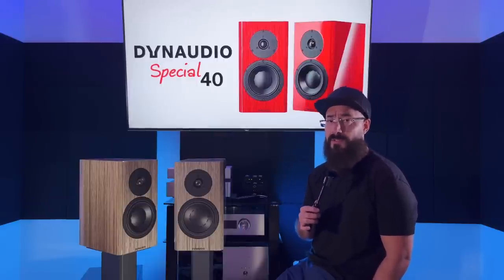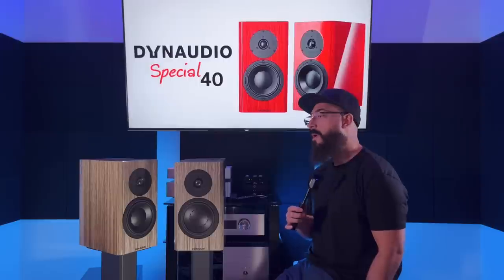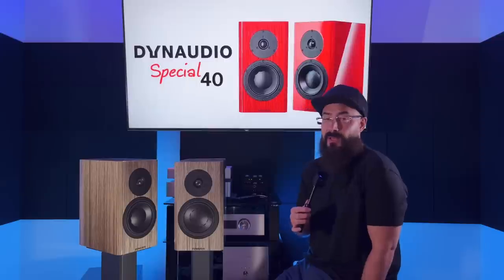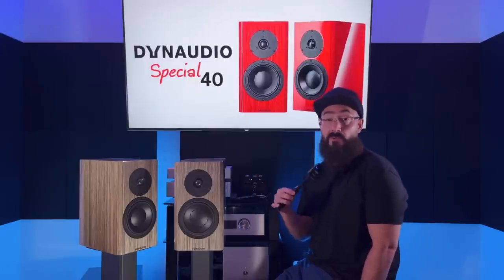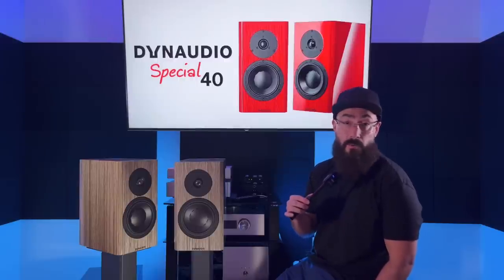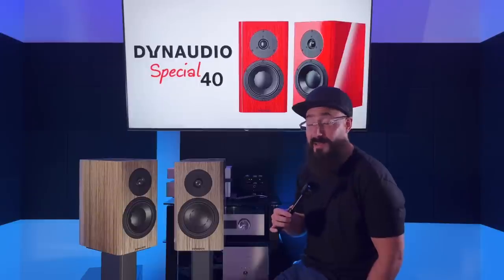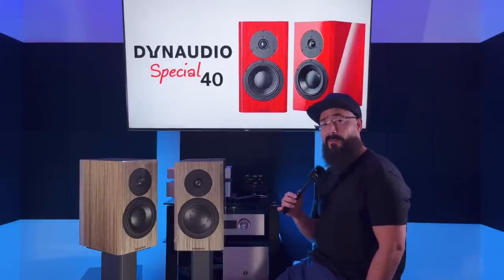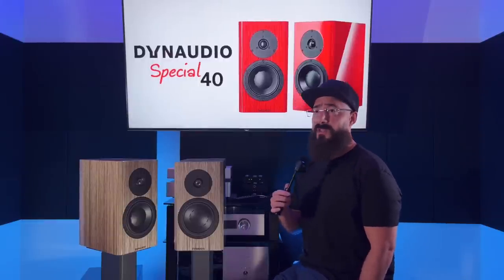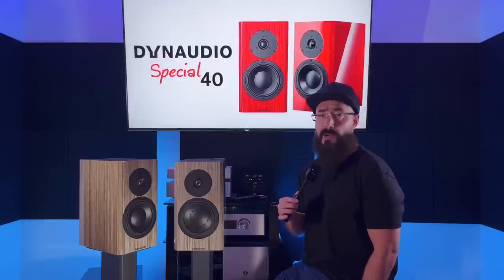It's going to roll off right around 45 Hz — and again, that port tuning frequency is right around 50 Hz, so that's no surprise. It's not going to extend like a subwoofer. If you listen to rock and roll or normal music with instruments, a subwoofer is optional. If you listen to rap or EDM and want that room rumble, you'll need a subwoofer regardless. It's a good speaker from top to bottom — it's easy to recommend, easy to listen to. No particular feature is over the top. It's just got a good warm tonal character and great detail. That's the takeaway.